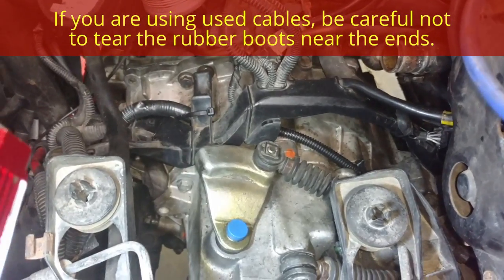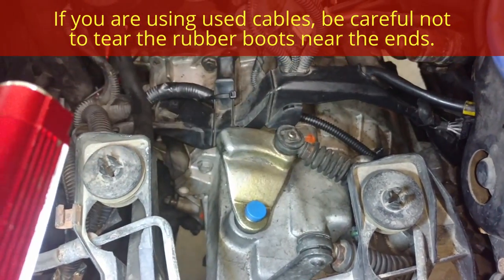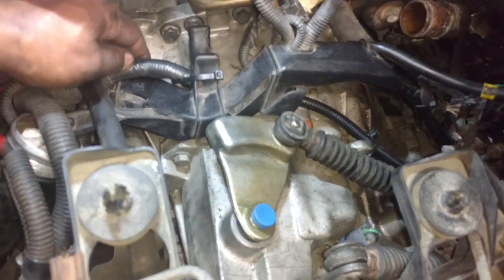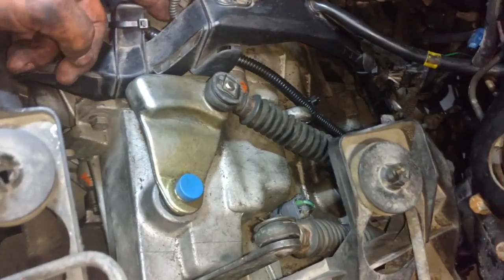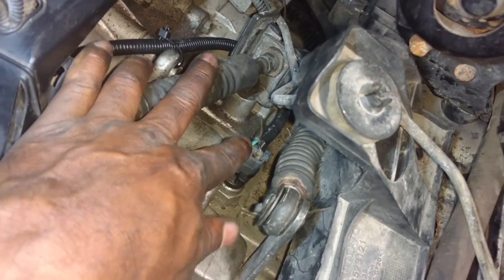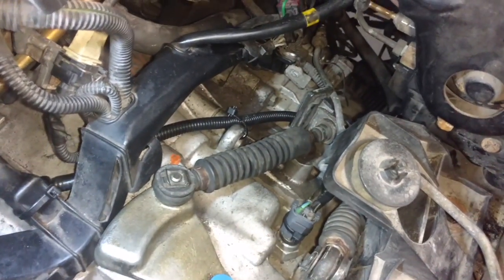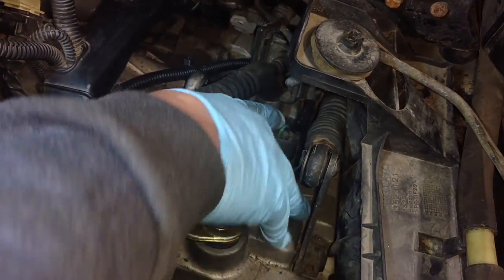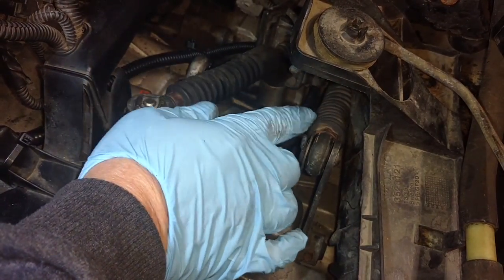P cable here, we've got that stashed away, and we took two wires out, put them in the loom, ran them down behind the bracket and up under and plugged them in to a plug here for the reverse light switch. This cable tie holds these wires down. You actually got to fold the wires down, and that keeps them clear of the movement of the linkage.